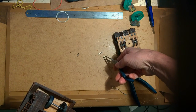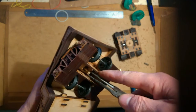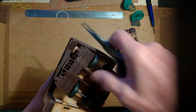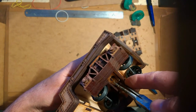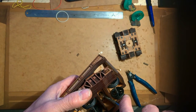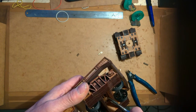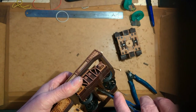Okay, so pair of pliers, hold the nut. I'm trying to do this while filming, which doesn't help. Push the bolt back a little bit so I can turn it from the back, and then while holding the nut on, rotate the bolt. There we go. Okay, that's good. Best thing to probably use here is a box spanner if you've got one. Failing that, long-winded method, or holding your finger on the bolt on the other side. Start to tighten down onto the spring.